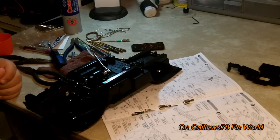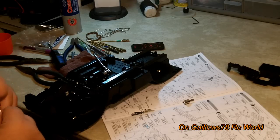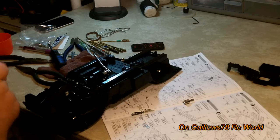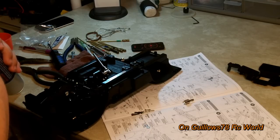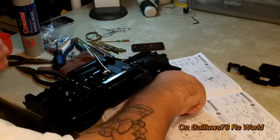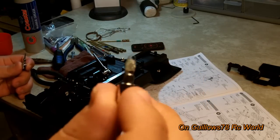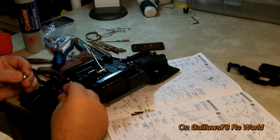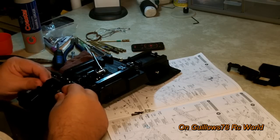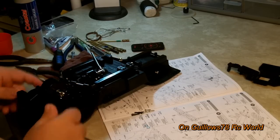Here, we are going to take our cups, our joints, gearbox joints. And we're going to go ahead and get our grease. We'll just go ahead and dip that like so up to the gear. Same with this side, we'll just give it a dip. Now, a nice amount of grease there. Just slide those right into position. It should slide together quite nicely.